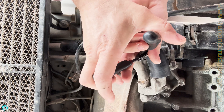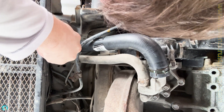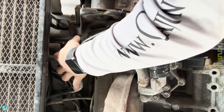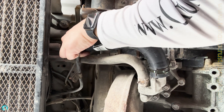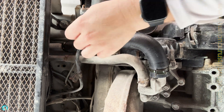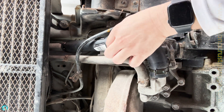Let's go ahead and get the clamps on. I actually have the special tool for these clamps but I could not find it — it's probably in one of my special tool storage cases over at the property. Make sure we get this clamp properly placed over the lip. We can feel the edge of the hose and it feels like we're right in front of the lip — nope, that's not going anywhere, so that's good. Let's push that hose up just a tad more. This is in the right place; there's the bump right there, so it looks like we are good to go.